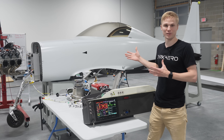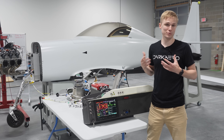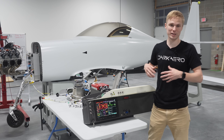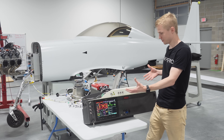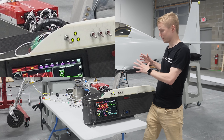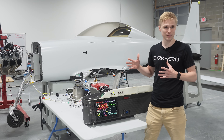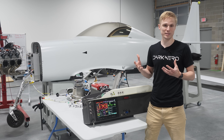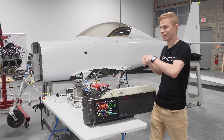We have the airplane here lifted off the ground for retract testing. The carts that it's sitting on were specifically designed for these retract tests so that we could move the gear through their full paces without interfering with the carts. In front of me we have the electrical system and the instrument panel pulled out of the plane for this test. The gear lights show us that each strut is in the down and locked position, as indicated by the three green lights. One caveat with this test is that we actually don't have the locking mechanisms in place, as we're still in the process of installing these. With all that said, why don't I flip the gear switch up so we can see how this all looks.